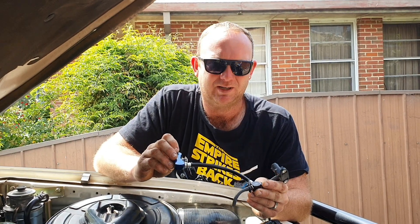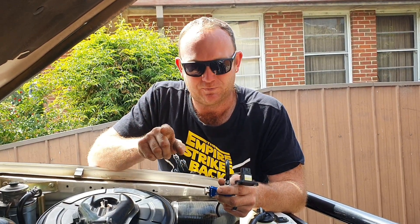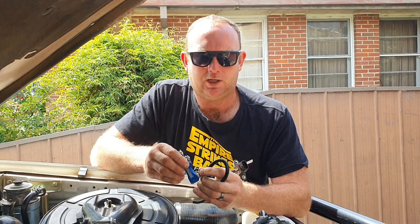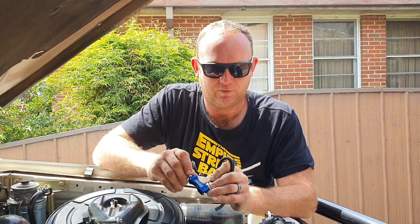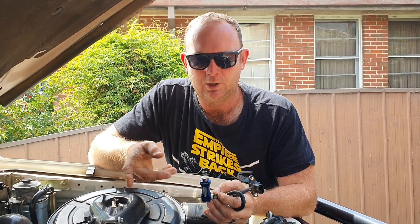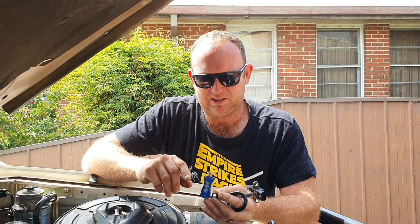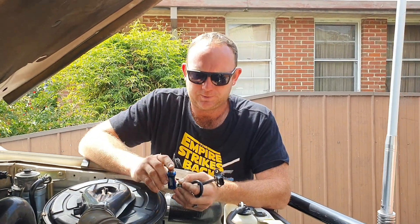That's the Fuel Cut Defender — it's very simple to hook up, nothing really major at all. Just find the vacuum hose. There's also a little filter there, so the hose comes off the boost pressure sensor onto a filter, and you splice into that. From memory, to get 18 psi out of this setup I had to wind this fully clamped to positive and back it off 13 turns — so 13 clicks with the boost wound up to 18 pounds. Different boost tees will have different amounts of clicks to set boost pressure, but for this Turbosmart Fuel Cut Defender it's roughly 13 clicks from positive clamp.